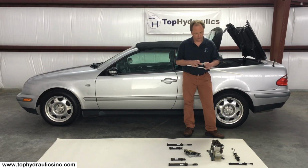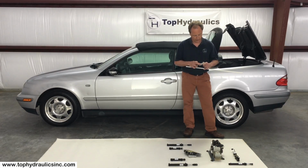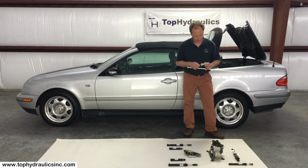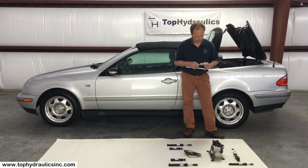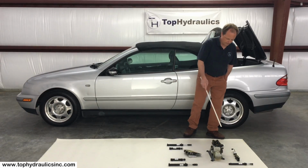These port seals will go bad with time, and there's no way you can fix this yourself. The port seals are behind bushings that need to be pulled with precise tools and put back into place correctly. And port seals are not O-rings. They are special edge-activated seals that Top Hydraulics molds out of Viton, which basically has an unlimited shelf life. Having said all of this, let's talk about the pump next.